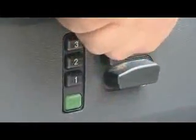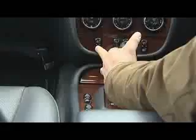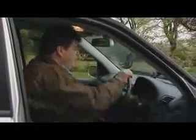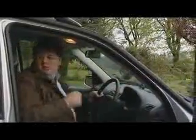When you move inside the car, check for signs of wear. Does it look like it's covered the indicated mileage? Shiny plastics, mirror-like steering wheels and worn gear knobs and pedal rubbers may suggest 120,000 miles and not the 20,000 miles shown on the clock. A saggy driver's seat may also suggest some heavy usage.